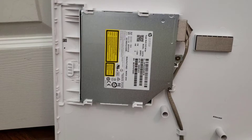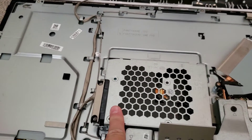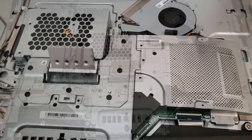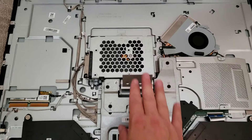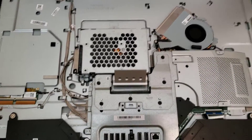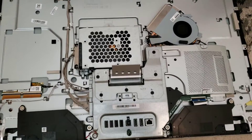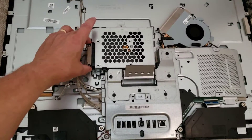Let's start with the easy stuff. The DVD is on a very long ribbon cable which snakes all the way back to the motherboard. This is your hard drive, which I'm going to replace with an SSD. There's your CPU fan and all your ports. Memory is under here. You don't have to take off this mounting bracket if you don't want to — it's attached just to the heat cowling and comes with it. The hard drive is really just held in by that one screw. You don't have to pull any of this off if you just want to change the hard drive. Just pop that screw at the back, slide this out, lift it up, pop off the SATA connector, and you're on your way.